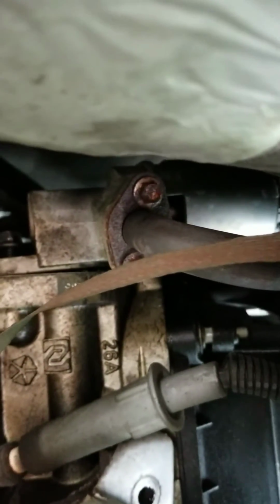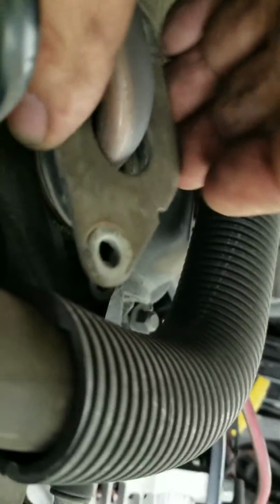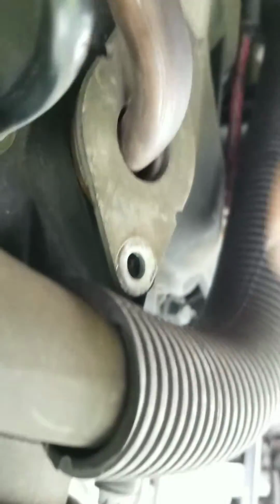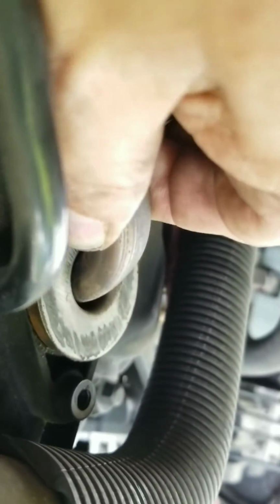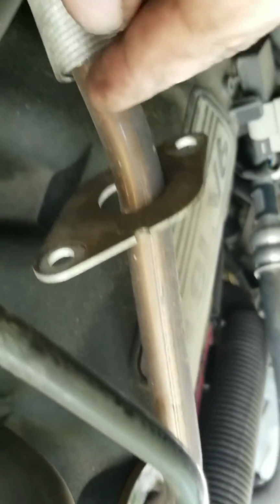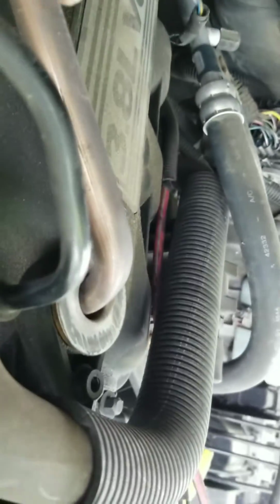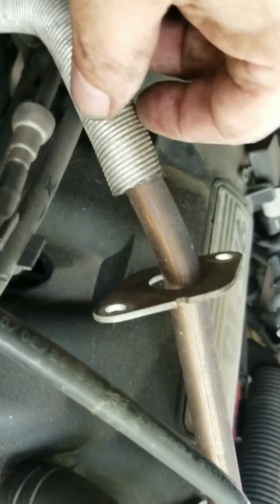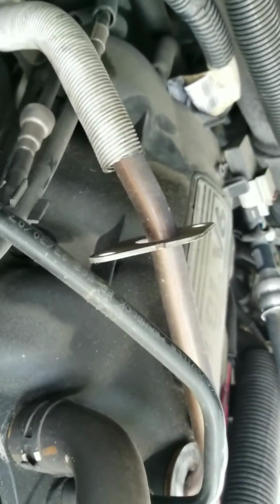But that tube that you see there with the 8 millimeter bolts connects all the way up here. That's this copper-looking one. I already disconnected this flange here that holds it down in place on top of the valve housing. I pulled that off, and as you can see, this wants to come free, but since this tube is rigid, not flexible, I'm going to have to disconnect it from the EGR down there first. I may not have even had to do this, to be honest. I could probably just attach that back, but just to make things easier when we go to line things back up, I'm going to leave it loose, and then once I get the EGR mounted and all that stuff, hopefully we can flex everything back into place, and I'll see you soon.